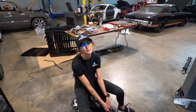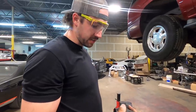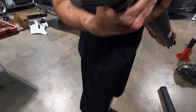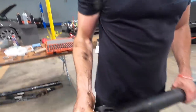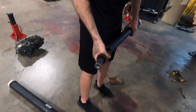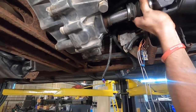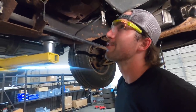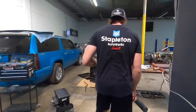Learn from my mistakes so your girlfriend doesn't have to suffer with you. Let's find out if these drive shafts fit — the guys did a nice job. They cleaned off this crusty front yoke, cleaned the rubber boot, put new clamps on it, and even cleaned off the old front shaft too. We're going to want some grease for that — I forgot how crusty that hole was. Yeah, that there is a dry hole — we don't want a dry hole, we gotta lube that up.